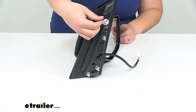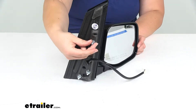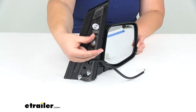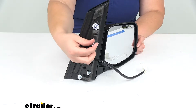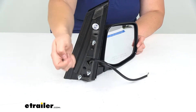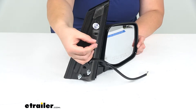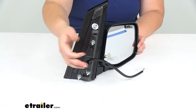We'll have some new flange nuts to attach our mirror with. Basically you're just going to pop out a panel on the inside of your Odyssey to get access to those nuts, remove them, unhook your wiring, and then pretty much repeat that same process in reverse to get the new one installed. Really an easy way to replace that mirror.